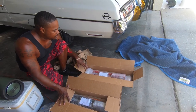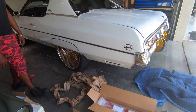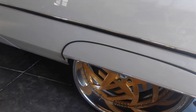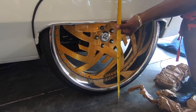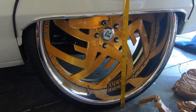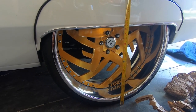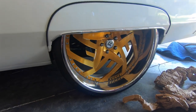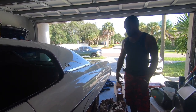I'm about to put them on, move this rear end back, and squat the car. Right now from the ground, where that skirt is, we're at 19 and a half inches. I want to bring it down to probably 18 inches — bring it down another inch and a half. That'll probably take me about an hour, maybe less, and then I'll show you what it's at.